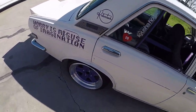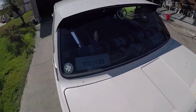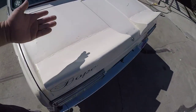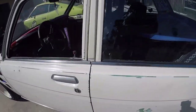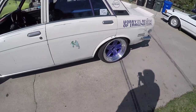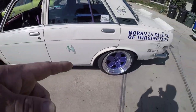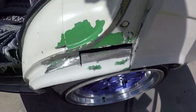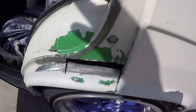The front of the car — like I said, we touched on this. This is all metal, made this a few years back. The wing is also made out of metal, which as you can see is not the prettiest — I never finished it, I kind of just got it white and left it alone. XXR 532s in the rear, roto-grids in the front — these are 16x8 and those are 15x8. I have to run 195-45s in the rear because it rubs. On 4-door 510s, to sit low you gotta cut this out. I don't recommend leaving it open, but I never welded it up, so I kind of need to get on that. It actually rubbed right here so you gotta cut all this out and weld it back up. We had welded up the other side and it still rubbed, so that's why I hadn't done this side yet — it really should get done before it rusts out.